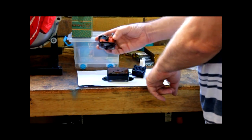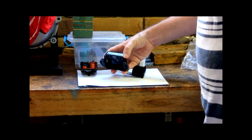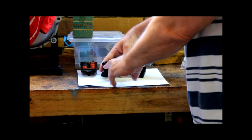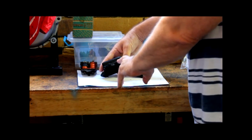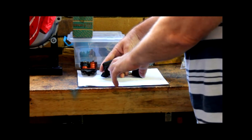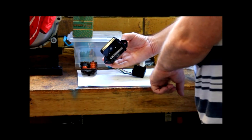In a nutshell, that is it. We haven't damaged them too much, so if some future person needs a good working regulator, that's fine. The base I've given a bit of a rattle-can paint clean-up to — make it pretty. There are markings on here: F, A, E, D. F is for field windings on the generator. D is for the dynamo — to the armature side of the generator. E is for earth. And A is for amps — it's your power out. This one is pretty knocked about and worn, so I've got my little label maker out and labelled the inside, just to make life easier for anybody later on.